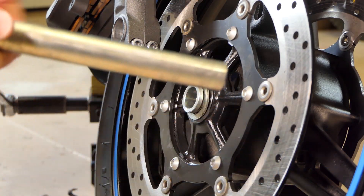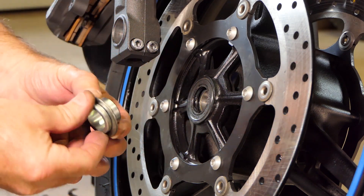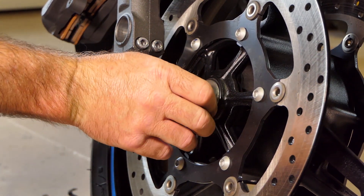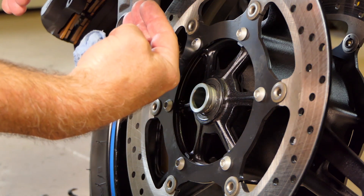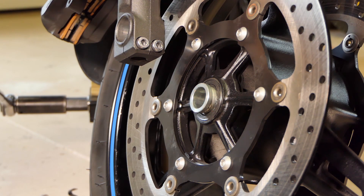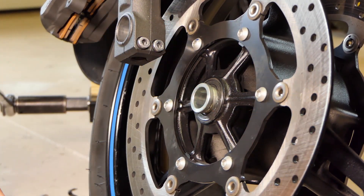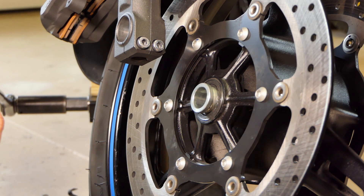I got the axle out of the fork. This is the spacer that goes in the seal, and they've just set this washer on here and stuck it in. I also noticed when I loosened up the pinch bolts on the axle that my fork sprung apart — so they were pulled together, they had side load on them, pinched together, and they sprung apart when I loosened it. That's not right either. That's going to put wear on the bushings in the fork leg where the tube runs up and down. I'm glad I found that before I took off on a big trip. So we'll figure out where this washer is supposed to go and put this together like it's supposed to be.